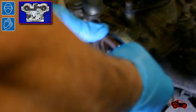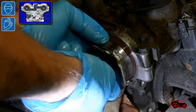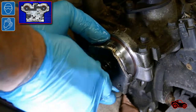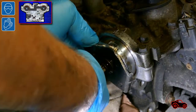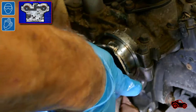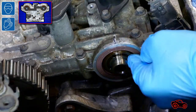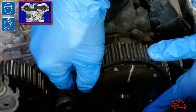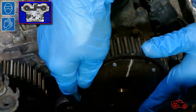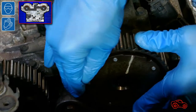When the surfaces were ready, I loosely fitted the oil seal and installed my homemade seal driver tool. With this tool, it is quite easy to press the oil seal into place. I stopped pressing on the seal when I felt it was properly seated. I cleaned the end of the shaft and refitted the VVT sprocket. To make sure the center of the oil seal would fit properly, I rotated the VVT sprocket back and forth while pressing on it.